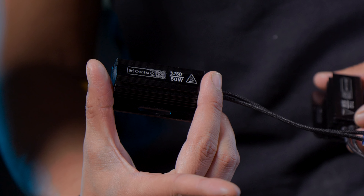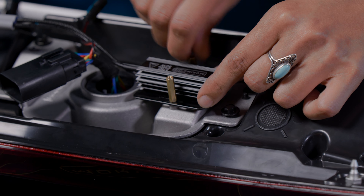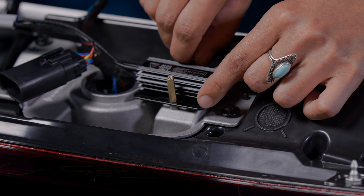If you're using one resistor — the 3.75 — you'll be installing it right here, using the two screws with the washer included in the kit, and just tighten those down. Now if you're using two resistors, you'll be using the 7.5 and also the 3.75. Take one resistor and place it up against the bracket. Take your two standoffs that come in the kit and line them up to the two back holes on the backside of your bracket and tighten those all the way down. Once those two standoff screws are installed, take your other resistor and lay it right on top of the standoff, then use the two smaller screws with the washers and screw those down. Now if you need the harness, each one of them will be labeled 1, 2, 3, 4, and on the very bottom will be where you'll be connecting your resistors. Also keep in mind there are dummy plugs on the top of these — this helps prevent water intrusion, just in case you do not use that plug, so leave these on there if you're not using the plug.